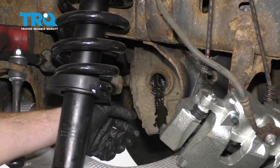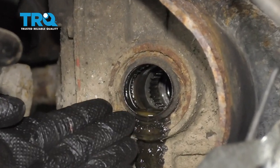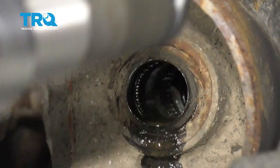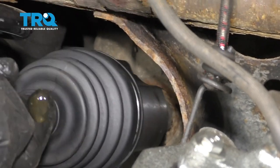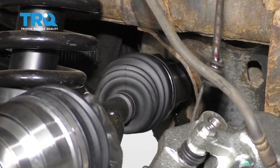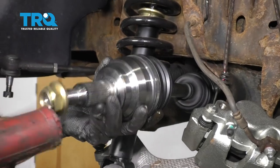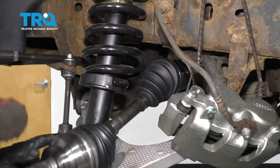Before we go ahead and put the axle in there, something important to think about is your seal right there — it's always a great idea to go ahead and replace it. For the purpose of this video, we're not necessarily gonna do that, so I'm just gonna inspect it and make sure it's not torn or worn in any way. This one looks decent. So let's go ahead and carefully slide it in — you should feel it wanna line up with the splines inside the front differential. There it is. I'm just gonna give it a couple of loving bonks with my rubber mallet. Give it a nice tug — it's definitely locked in.